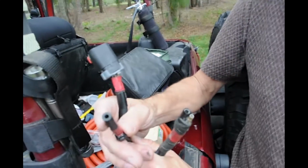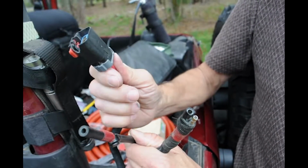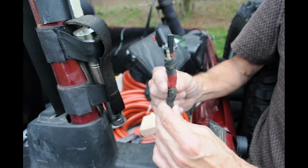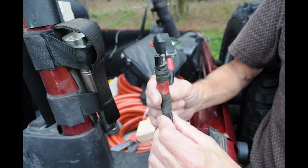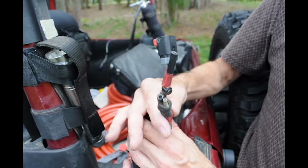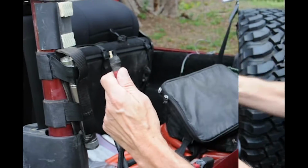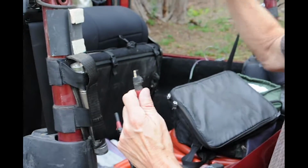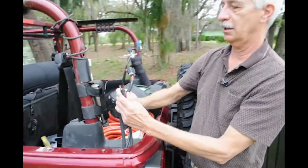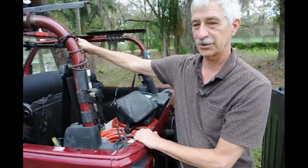This one's your water connector for the wiper that's on the rear window. This is your communication for the wiper on the rear window. This is our third one that we added into the same location, and that's just a 2 connection for a trailer, and that carries the electric signal from the dedicated third brake light circuit that we moved off the rear to here. When you put the top on, you plug in here, and your outside light on the back of your top is connected. When you take your top off, not connected. The one up here still works.